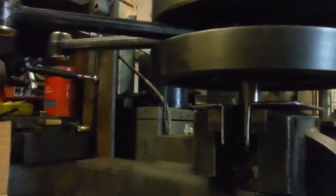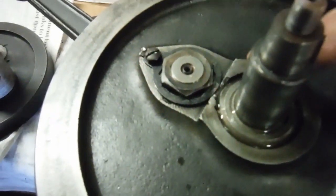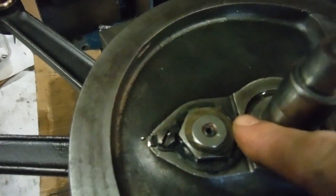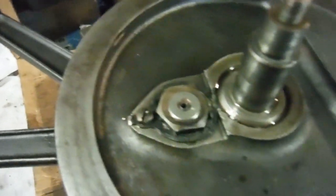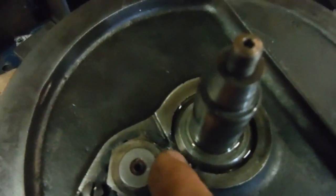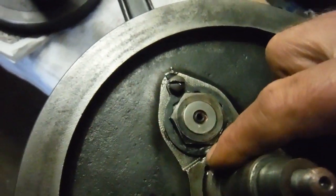The reason I've got it held like this — you'll see in a minute. The oil feed to the big ends on these goes from the main bearings via a close fit to the faces of the main bearings, by this flat area here, which is on both sides, both flywheels. So there's an oil feed on either side. I'm also going to have to repair that a little — there's a chip, which seems to be a common thing.